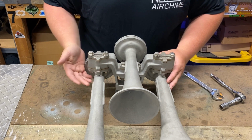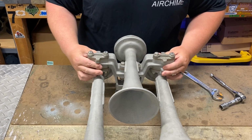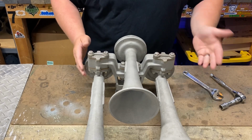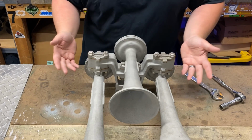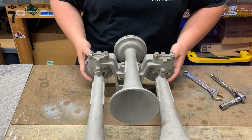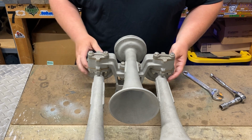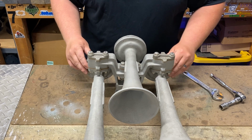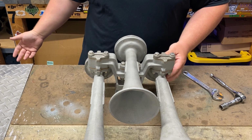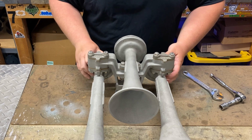Your standard P3 has bells 1, 2, and 4. This mount is also used for a P5. It's missing bells 3 and 5. So if you wanted to make it a P5, you could add bells 3 and 5. There's also a low profile P horn manifold. The red and black new cast horn I had out a minute ago is on a low mount manifold, so it has to be 5 bells. There's also a 3 chime low mount manifold too. I've got one of those over there.